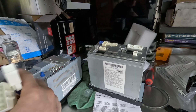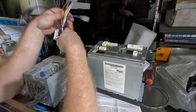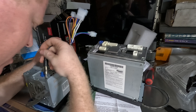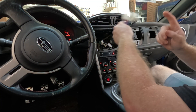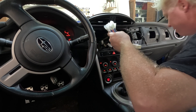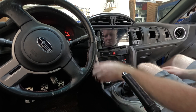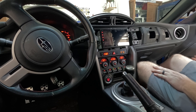From what I can tell, there's only one primary plug for this head unit, which is right there. Everything else is pretty straightforward — this looks like it might be for my antenna, so let's go ahead and plug that in. Quick tip: plug the adapter harness into your factory harness before plugging it into the new head unit.